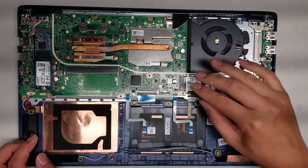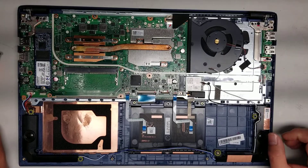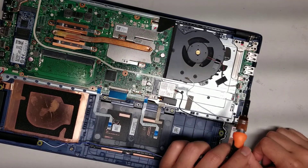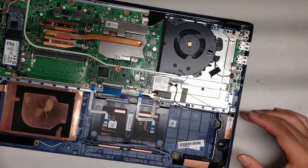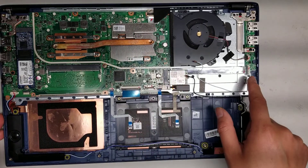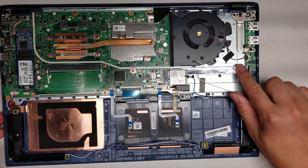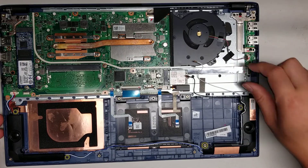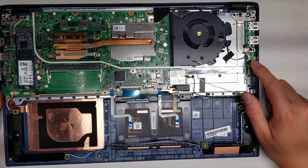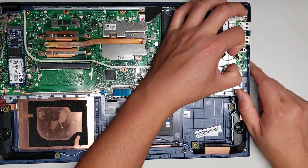The wireless card: remove the one screw, it'll pop up at an angle just like RAM sticks do, then wiggle it out. To put it back, insert it at the same angle. There's also a cable for the board with two USB ports and two lights, which also controls the fan. That cable runs underneath the board, so to remove that side you'd have to take the board out. The other side you can remove by flipping the black part of the latch and pulling the cable out — there's adhesive holding it, so be careful not to bend the cable too much. The fan connector: grip it with your fingernails and slowly wiggle it until it pops out.